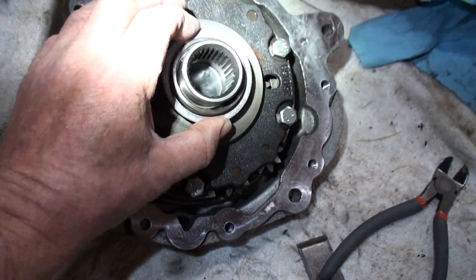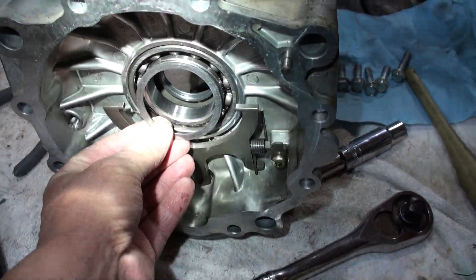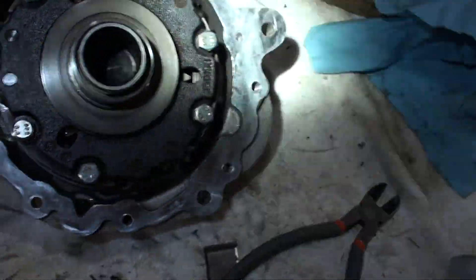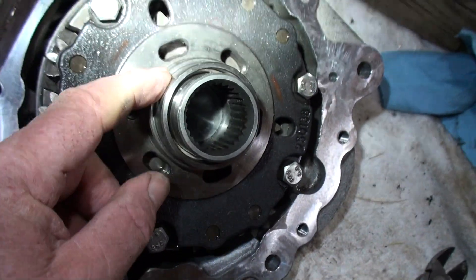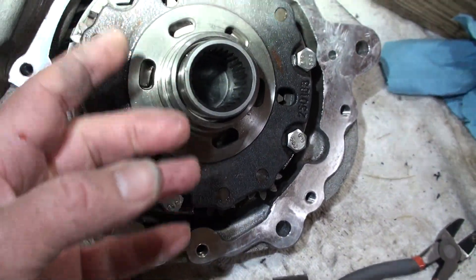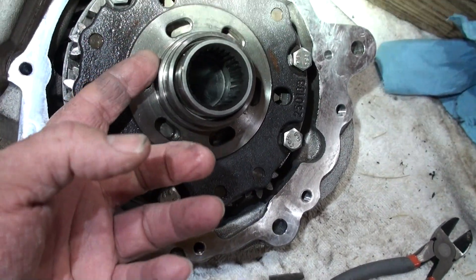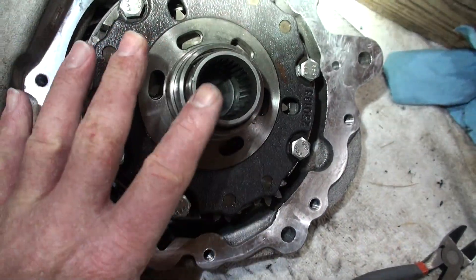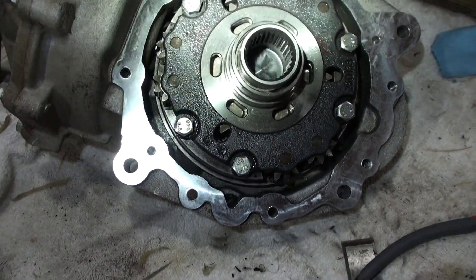Here's your shim, which goes on the back side of this. It fits right up against this bearing here — this is really how you set your preload and backlash. It lays against this edge of this carrier, down against this edge here, holding it up against that bearing, which keeps this from coming this way. On the other side you've got a similar thing — your ring gear and a bearing on the end of it, and behind that bearing you've got some shims. The difference between the shims on that side plus this shim here keeps this carrier in the right position, giving you a proper wear pattern.